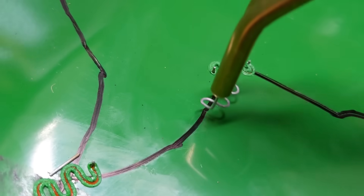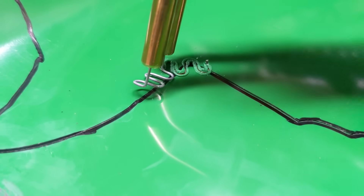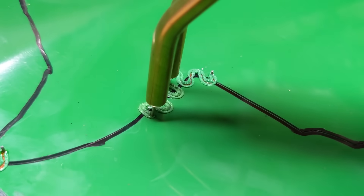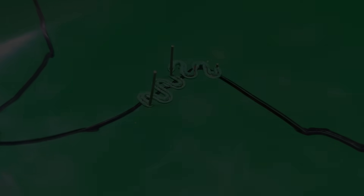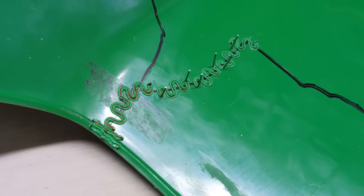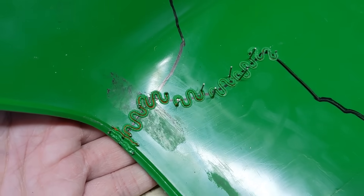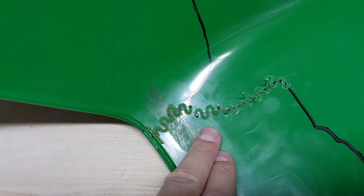When using the wave staples, I'm not going straight to the crack line — I'm offsetting at an angle so it ties in both edges of the crack, giving maximum coverage with the element on the plastic. Also for safety: don't put your hand directly underneath the area you're hot stapling because you can feel heat from nearby staples even after moving on. Try to put your hand off to the side or set up on a workbench so nothing is moving around.